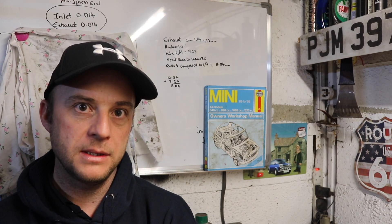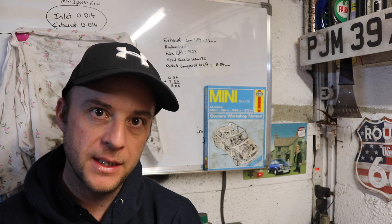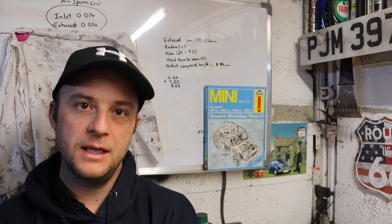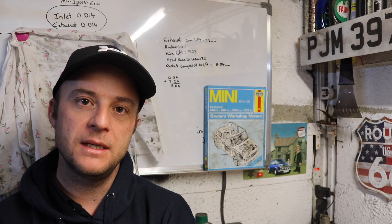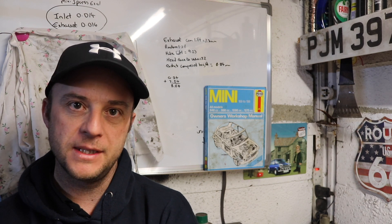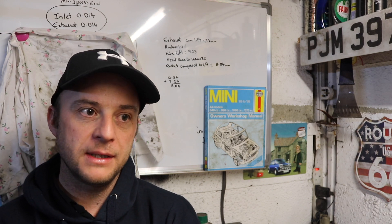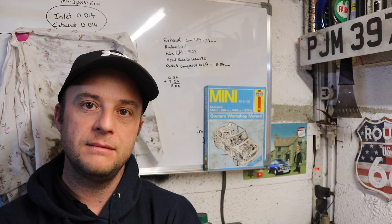The next video I'm hoping to clarify my measurements with the engine, mark out where the reliefs need to be, and double check my cam timing — because that's quite important. I set it roughly with a recommended size offset Woodruff key when I fitted the cam, and I want to verify it. Once I've got my DTI I'll be able to verify that. Short one for this weekend — there'll be another video out next weekend providing the parts come. I'll see you then, thanks for watching.